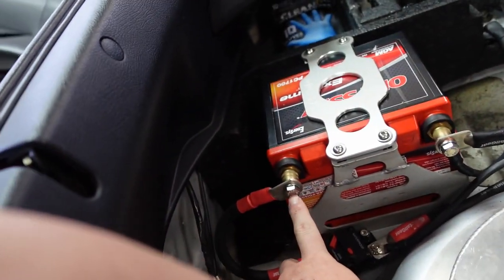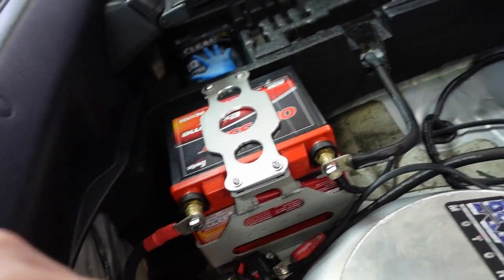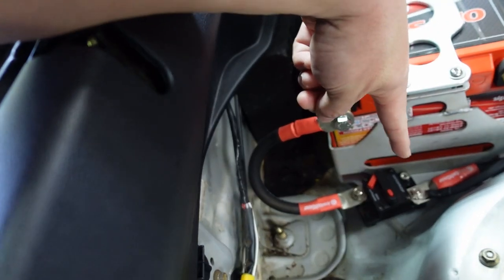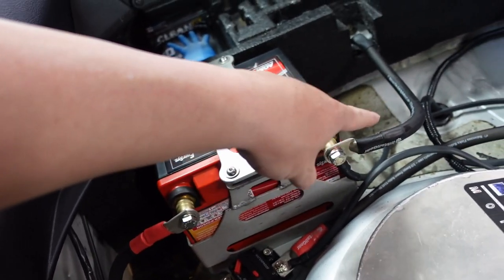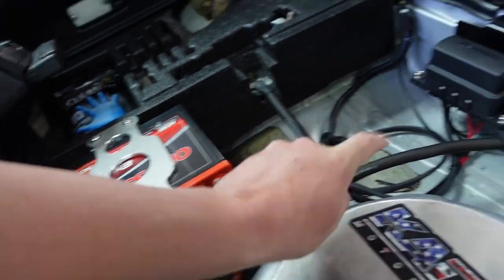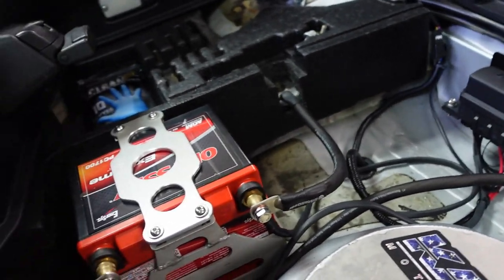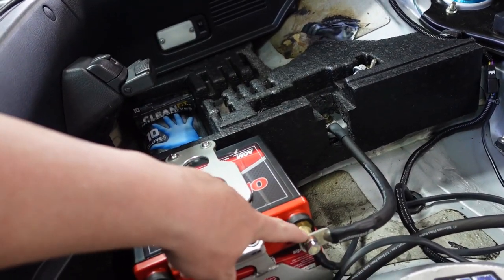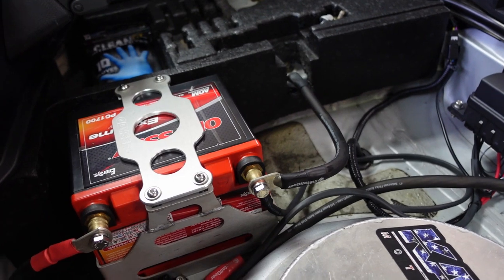I did take the power from here and moved it because I was giving 12-volt power constant to the fuel pumps — there's a reason why the switch is here. But I don't like that either. I'm going to remove this and make a little lug station out here, and have all the power for the power stuff go there. I need a grounding station too — I've got to ground here for the fuel pumps. I need to shorten up that wire — that can be dramatically cut down. There's going to be another ground lug that needs to go to the front.